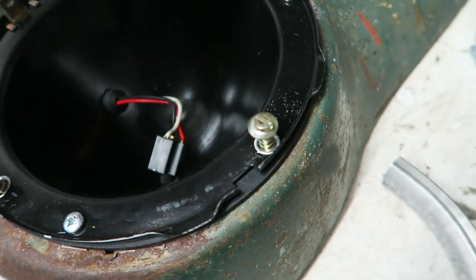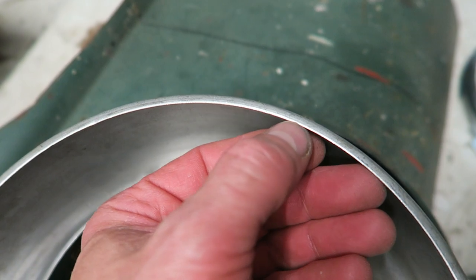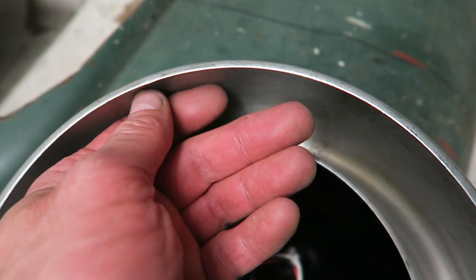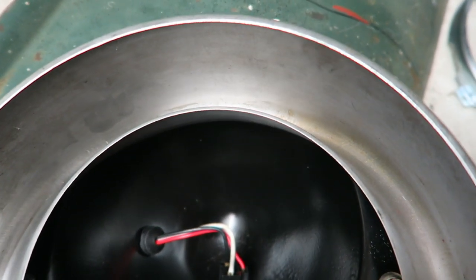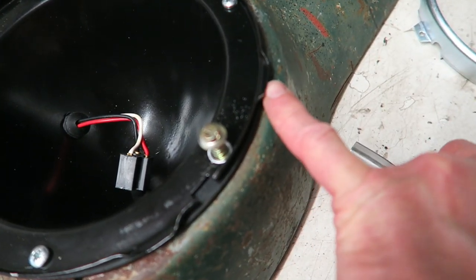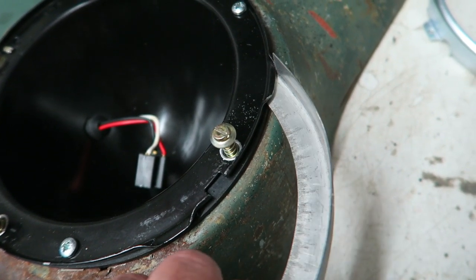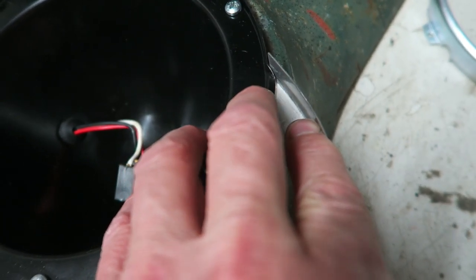And then on the rear lip of the bezel, I just weld two ears here. They can come down quite a little way. Actually, not too far, because you've got to remember that you've got to hook it over the headlight. So maybe 2 or 3 millimeters down. Those ears on the back of the bezel could just hook under those and squeeze between the rubber gasket and the headlight bowl itself, like that, you see. See, that's jammed in there really nicely.